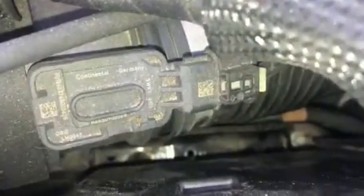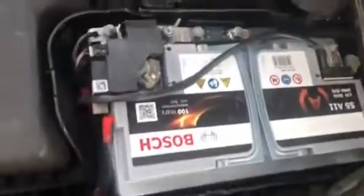So we just successfully manoeuvred the battery bracket back in place, and it took a bit of doing because there isn't really a lot of room down there, but we managed without removing that air duct there. The only problem is getting the bolt in, so I've come up with a little plan. We've got the nut wedged into the socket with a bit of polythene there, and hopefully that'll work. Well, that works a treat. Only problem was the polythene got wrapped right round the screwdriver, but it's in.